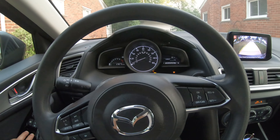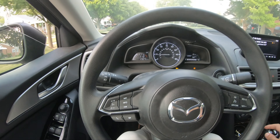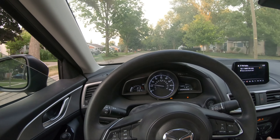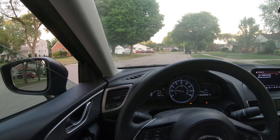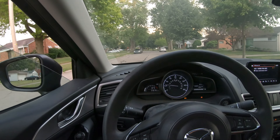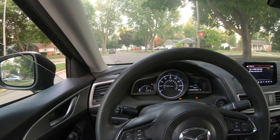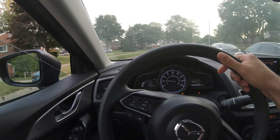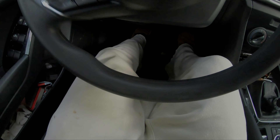We're going to take her for a quick test drive just to make sure she feels good. Yeah, you can feel it — the engine's feeling a little bit smoother. You don't notice it when it's starting to run a little rough, but you notice it when it starts running smoother. Anyway, I recorded the mileage, the date, the brand and type of oil, and the brand and type of oil filter. That's what I do for my oil changes. I hope that was helpful — this has been a fun little video from Dwight's Dojo. Have a good day and see you later.